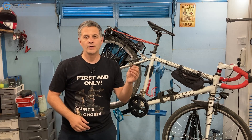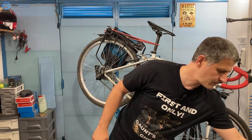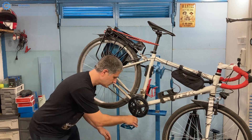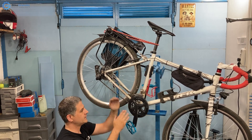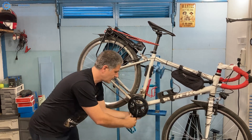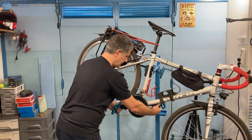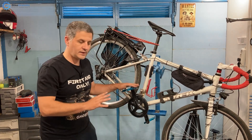Just make sure your bearings are intact. The first thing I do is inspect the bearings for play: I put one hand on one crank, the other on the other, and try to rock them. They should always provide some resistance in any direction. If I can easily move them and feel rocking, that's not good. I do this on vertical, horizontal, and a few other positions, because bearings don't always wear evenly.